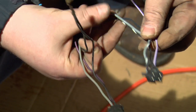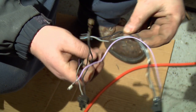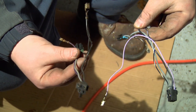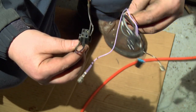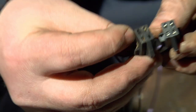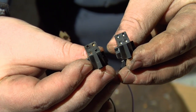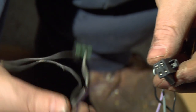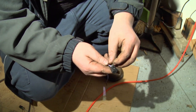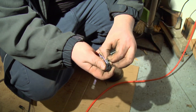This one's got the ground set up differently, so I'm gonna have to solder — take this wire off and solder it to this one to make it match the original harness. First we're gonna start with reconfiguring the pins. You can see the old harness, the new harness, and there's the melted connector.